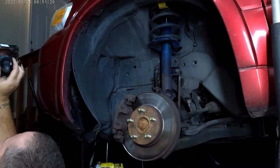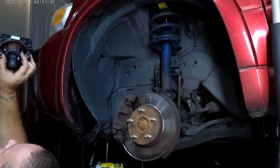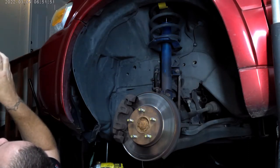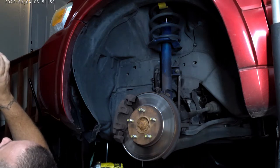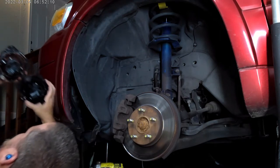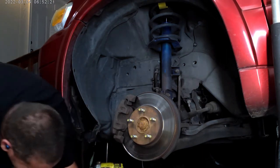Looks right. Plug looks right. Bulb is the right number. Huh. Yeah, there's supposed to be a lock tab right there that clicks in. It ain't clicking in. Not really any way to adjust that. I'm going to switch that back ring. Yeah, looks like it. Alright. Time to do a little bit of surgery because I don't want to put a light in the bulb's just going to rattle out of.